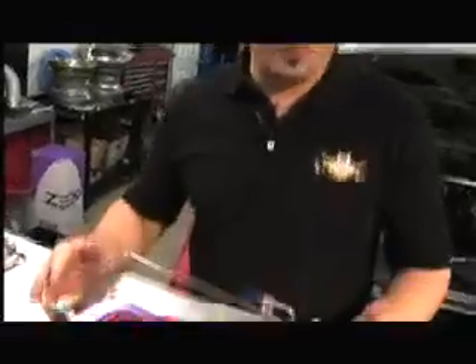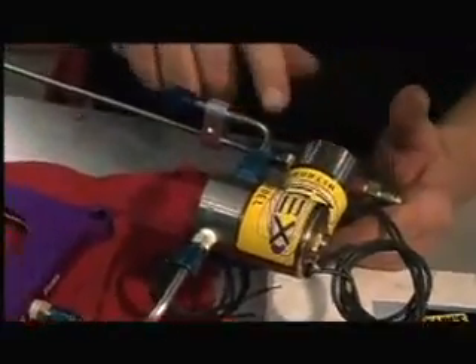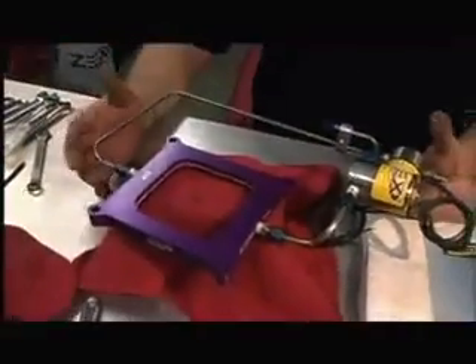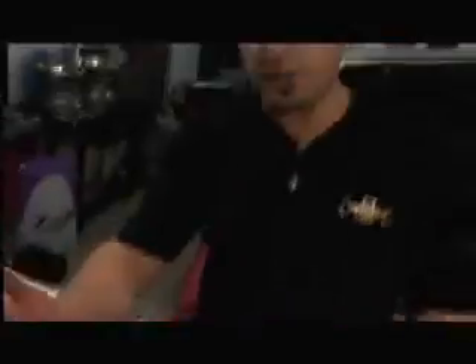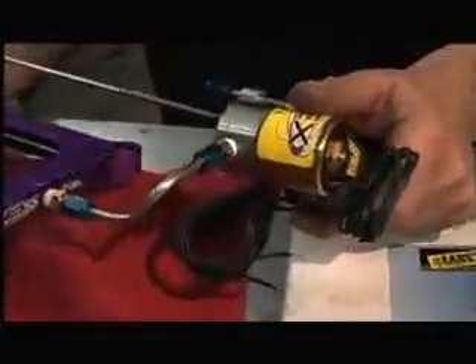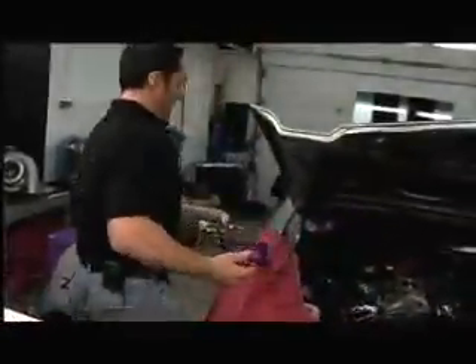Here's our finished nitrous plate system. The nitrous oxide comes to the front of the solenoid; when it leaves the solenoid it goes into the nitrous plate. The fuel solenoid does the same thing. Our nitrous line is significantly longer than the fuel line — I did that on purpose. Nitrous systems seem to have a softer hit, meaning it doesn't explosively apply power to the rear tires. When you're driving a street car on radial tires, it's a lot nicer to have a graceful application of nitrous oxide. When 12 volts gets supplied to the solenoids, it comes out through holes around the perimeter of the plate going into the intake manifold.